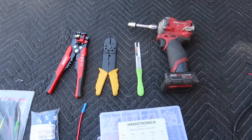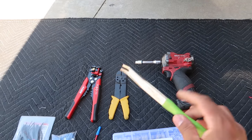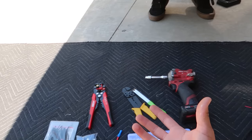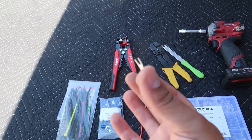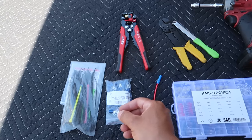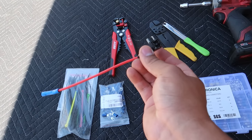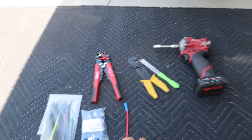As far as tools, you're gonna need a 10 millimeter socket or wrench, a panel removal tool — we like this one because it works really well — a wire crimper, and a wire splicer. To keep a clean install you'll also want zip ties. We're gonna be using a spade — it's an open end but we'll swap it out for a better one down the road. This one's gonna be used for our ground. We're also gonna be using an add-a-fuse — on Toyota fuse boxes it uses the mini fuses. That's basically all the tools and stuff you're gonna need. Super simple install, just follow the steps.